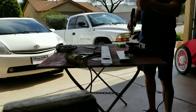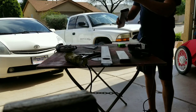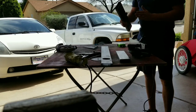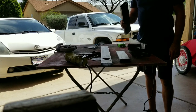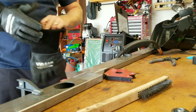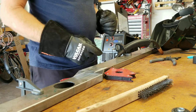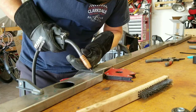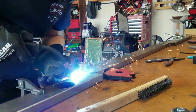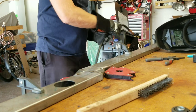The reason I cut it going around all four different sides is: if you try to cut all the way through and then cut down this side and that side with a hand saw, sometimes you end up with a slight angle and it's no longer square. We want these to be as square as possible. That cut came out pretty flat, square, and true — that's why we do it that way. We're all set to go ahead and tack weld this side — this is the driver's side frame rail.